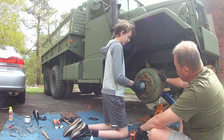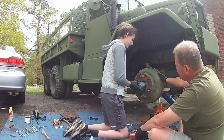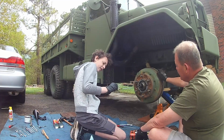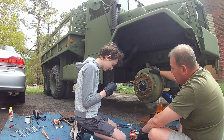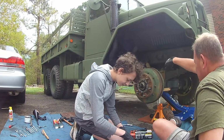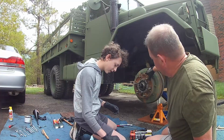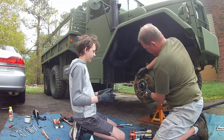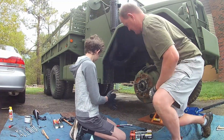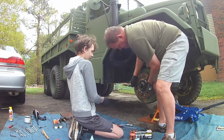And there's our first bearing. Excuse me, you gonna come out? There you go. Right, make sure it goes down in the tray properly. This one was backwards as well. All right, well, let's put them in correctly this time. Now we're going to wiggle this drum cylinder, and that's going to move this outer race, or bearing, and help it get out of there. Got it.